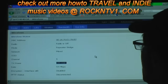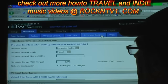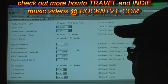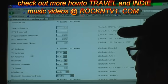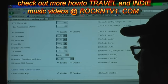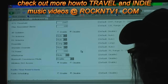All of that can be changed in the administration. You go to the wireless, then go to your advanced settings, and in this page you can change most of the radio hardware settings: the beacon interval, the DTIM interval, and a bunch of other things — also the output power, the transmit power of the radio that's actually in there. As you can see, mine is set right here at 230 milliwatts, and that will be the output power of the radio on the wireless end of the network routing capabilities of this router.